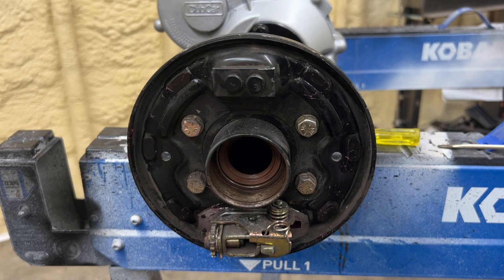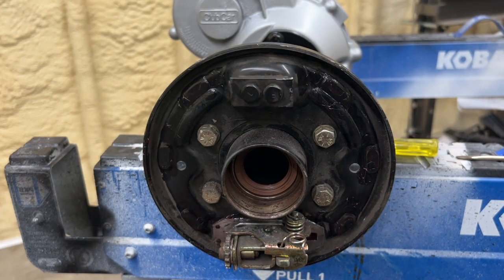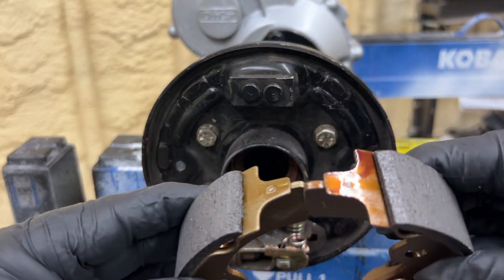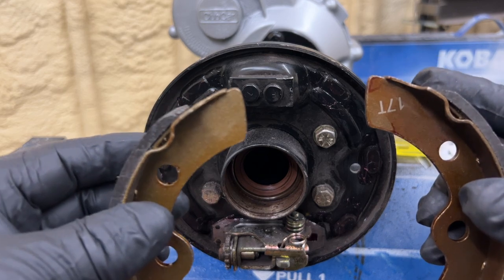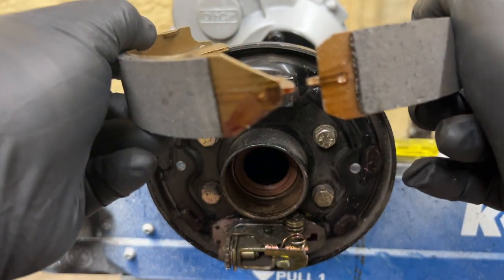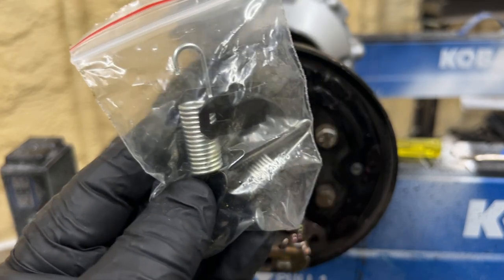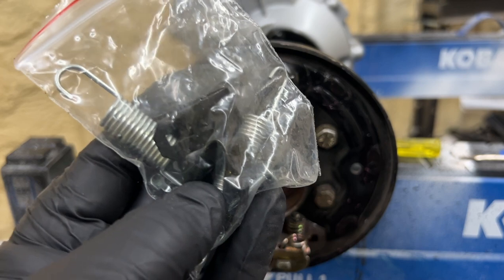You definitely don't want to get any kind of grease onto the brake shoes, so be sure to put on some new gloves at this step or wash your hands properly. There's a proper way to put the brake shoes on — there's a proper orientation. This is the proper orientation: this is the top right when you're facing and looking at it. You can see the 17T and it's upside down. The other side matches just like this. We bought our new brake components from Amazon and I'll place links to everything in the description below. We've got new springs, new pins with new clips, and we're going to be using all of those in this video.